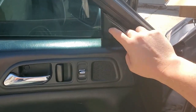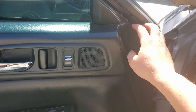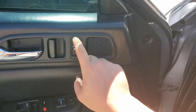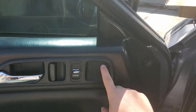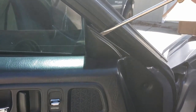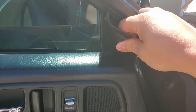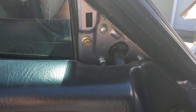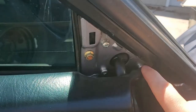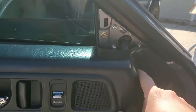First thing to swap out the external mirror, you got to go inside and you have this little plastic piece right here — a piece of trim — you pop that off. Then one of the screws is slightly behind the door panel, so we are going to have to pop the door panel off slightly, which means we're probably going to have to pop this off too. All right, here we go — we have three screws for the mirror: one, two, and then the third one is kind of hidden behind there, so we got to take off the door panel a little bit just so we can move it out of the way to get to those screws.